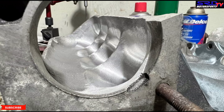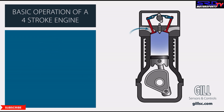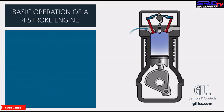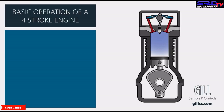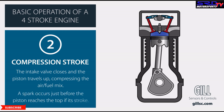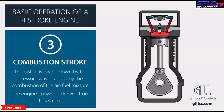Improving efficiency means increasing horsepower in a positive way. Hopefully this sequence now looks to you as it looks to me — that's how it keeps me up all night trying to figure out what to improve, even though it's already good enough. We're humans; we'll always try to push the limits. As the chamber is filled really well because of the efficient intake, now it's the compression stroke. When there's more in, there's stronger compression. Then obviously the spark sequence — when it sparks, because there's more in it, that produces more power. That is why it's important — all of this is connected.